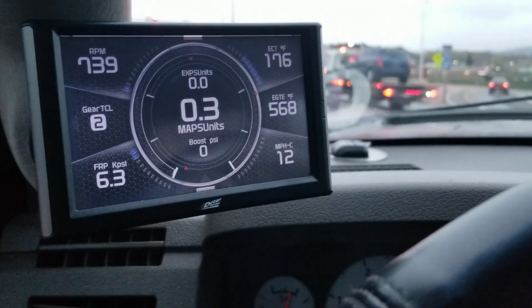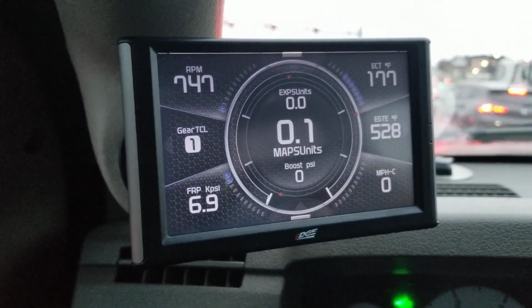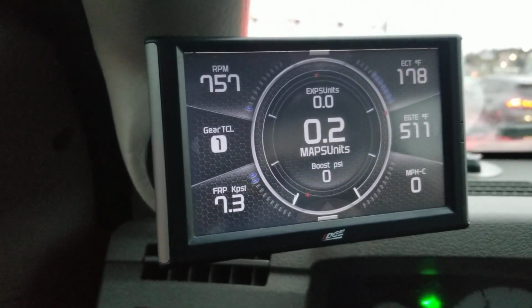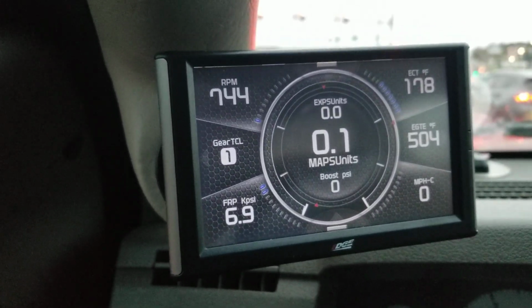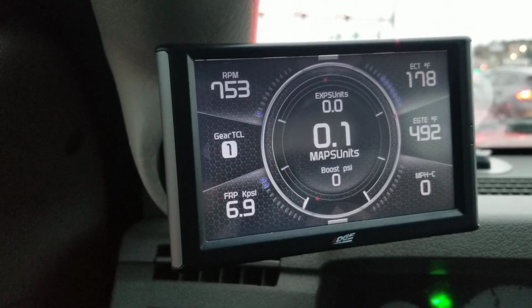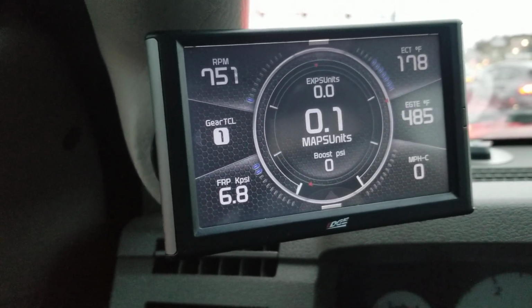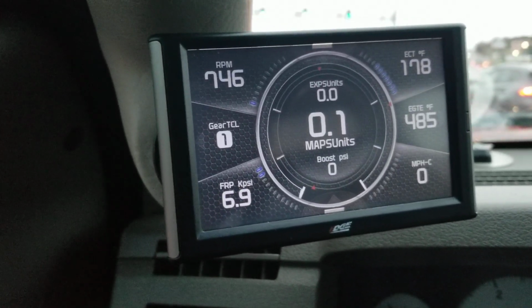So when you first take off, or when you really load the engine down, you're going to have more exhaust pressure than that 1.5 to 1. And then over time, the controller will calculate where it needs to be, and it's going to open or close the turbocharger to get back to that 1.5 to 1. And that delay is there so you can actually have energy to get the turbo to start spooling.